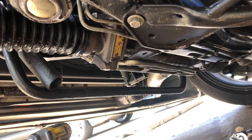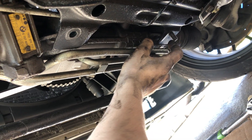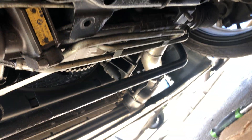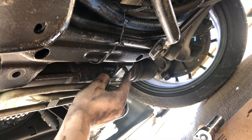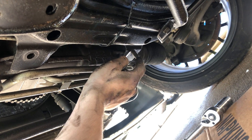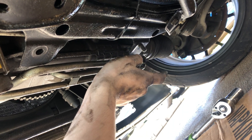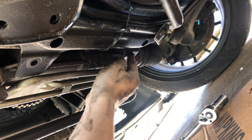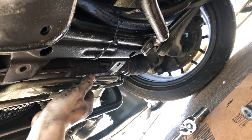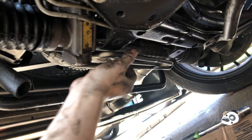I need to slide out the steering rack, catch the grooves again, and do the same thing. To remove the steering rack there should be one bolt right here and another one right there. I dropped them down because even if the nuts come loose and fall out, you still have some support — the bolt stays and the rack won't sway. If the nut falls off at the bottom, the bolt keeps the chunk from moving. My steering rack had a lot of play once before and I almost ended up in the curb, so be careful with that.